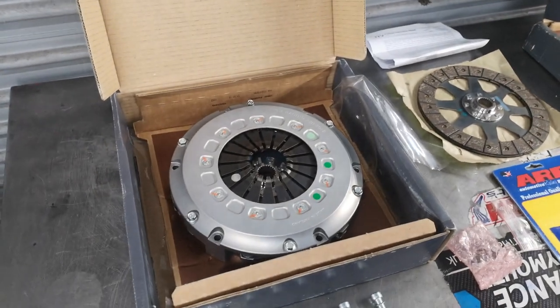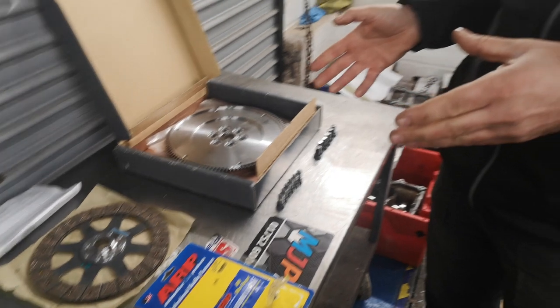The only thing, like I said before, in discussions I have with any customer before they decide what they want to do with an upgraded transmission side of things, is the pros and cons with regards to refinement. The ST250 that we've done for Stuart, where we put the Mark III Focus RS flywheel clutch upgrade in it with a Quaife diff, he wanted to retain the refinement. His wife drives the car, so it made sense. I wouldn't be recommending a paddle clutch like we run in the Fiestas or the ST225s, because that wouldn't be for him. So it's really important to discuss that with customers. The customer makes the final decision from the information they get from us and what we would recommend, and then you go from there. For us, racing around in the field, that's fine, but if it's your daily, you need to think about what type of aggressiveness you want from your clutch.